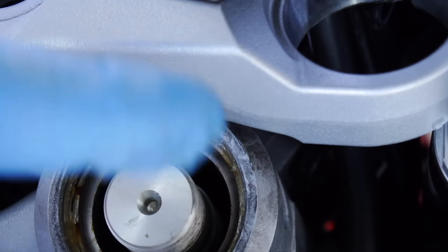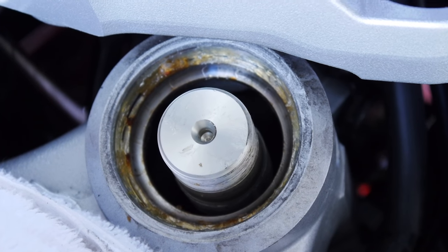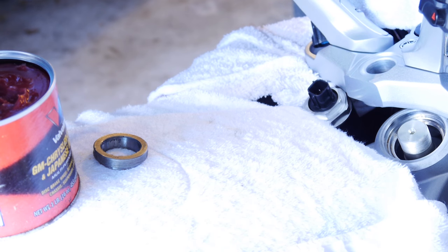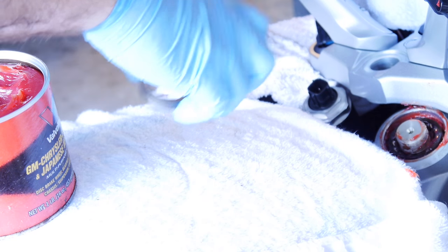We're putting on fresh lithium grease — brand really doesn't matter in my opinion. I'll quickly wipe that out with a little paper towel. If you needed to completely clean it, they recommend kerosene — just be careful of any paint. For the bottom, I got in there as best I could, smeared grease everywhere, turned the balls around on the stem, and packed them as much as possible. It makes a little bit of a mess but everything will be cleaned up after reassembly. We'll do the same thing on the upper.